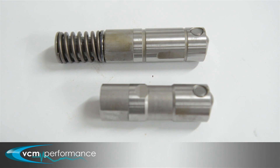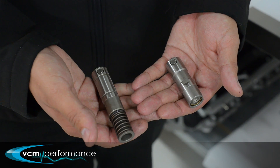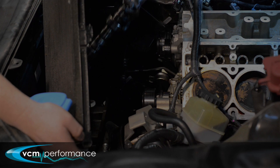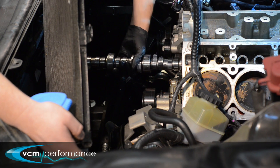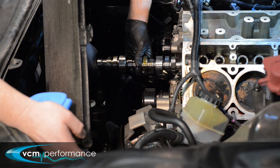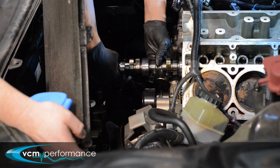The main issue is the lifters. There's an odd set of lifters in the car for when it does drop the displacement — you can see the lifter has quite a big spring on the top of it. When you fit camshafts with big lifts — the standard camshaft is low 200s in duration and around the low 500th-of-an-inch lift mark — guys start putting camshafts with 230–240 degrees duration and 600th-of-an-inch plus lift, and there's a problem with that spring: it actually breaks. It may not break straight away, but over time you'll definitely have an issue.